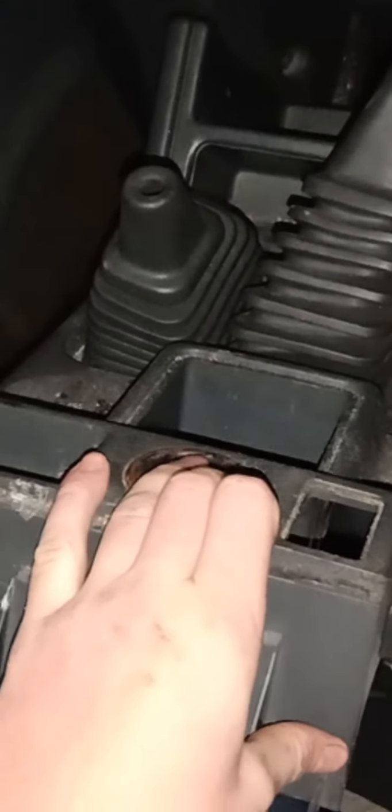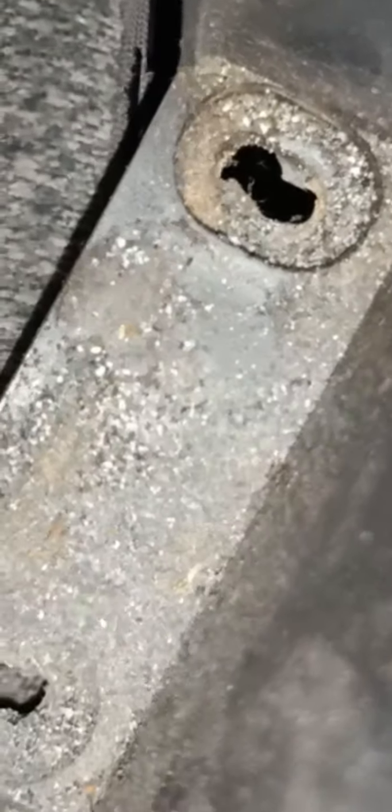If we get in and have a look — to get this centre piece here off, take the ashtray out, and that's it, just the ashtray out, then that will come out. But to get that off, you need to unbolt the centre console. There's two screws down in there and two more screws, then this here just unclips and you pull that off, pull it backwards out of here. Then this here all unclips — you've got one plug that controls everything right here. Then you've got two screws up here on either side to unbolt and then this will just pull off.